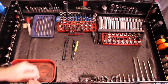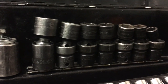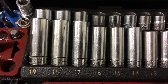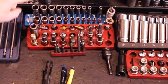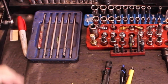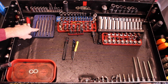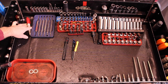This socket is what I use to press back the sleeves in alternators. It's also a 21-millimeter socket, which I use for strut mount bushings on Mark IVs. I have a series of 3/8 drive wobbler sockets on this side — this is my 3/8 side, that's my quarter-inch side. 3/8 drives: 19-millimeter to 8-millimeter sockets, Snap-on, which I've had since I started working here. In the back are my quarter-inch drive sockets. Quick-connect quarter-inch T20 through T30 long bits, a Phillips head bit, and a small punch I used for viscous couplers on 1.8 turbo Passats and also for taking off timing belts.